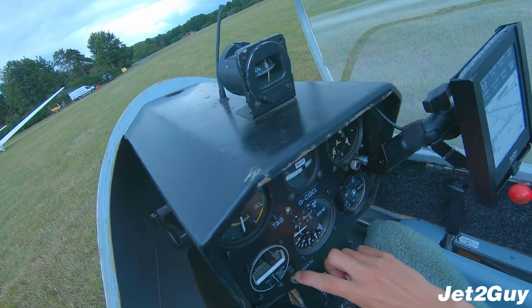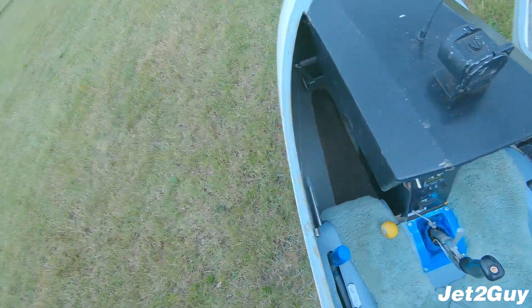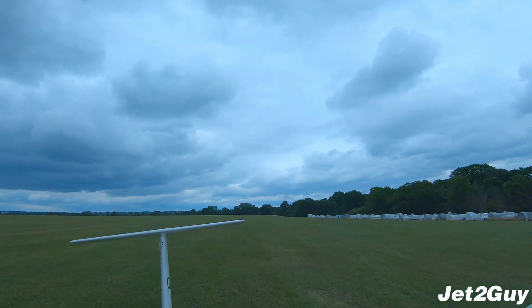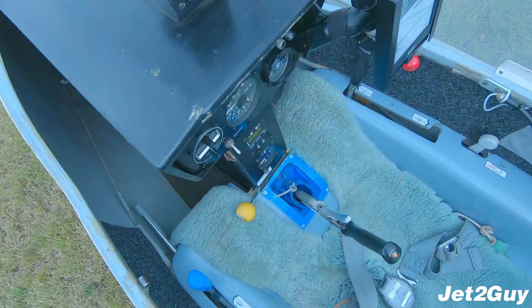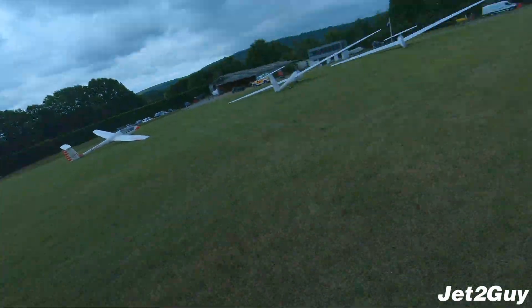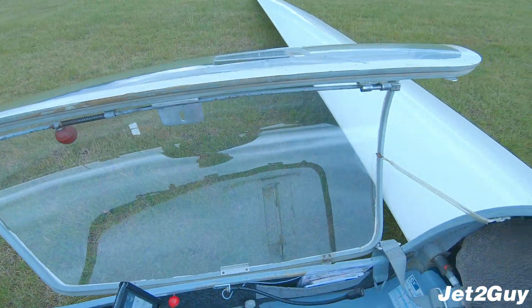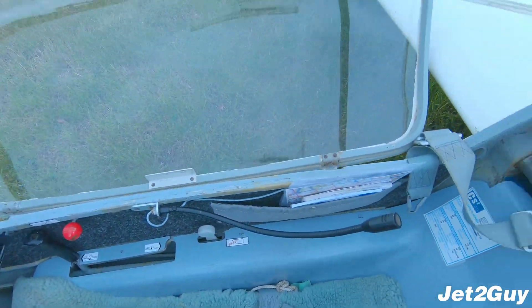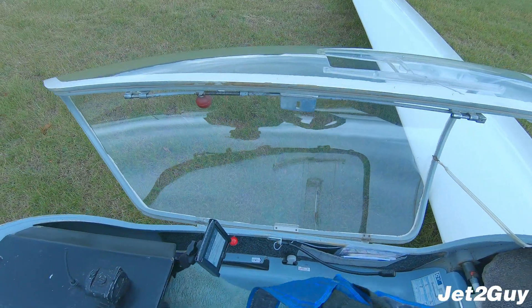Obviously make sure there's no damage to the instrument panel as usual. There are no flaps on this aircraft so I skip that. For trim, I push it full forward — you can see the elevator deflects downwards — then full up and the elevator deflects upwards. Trim is set to neutral. Then for the air brakes, I open them fully, then to 50%, then closed and locked. We don't need to check canopy and eventualities since we're not actually taking off.